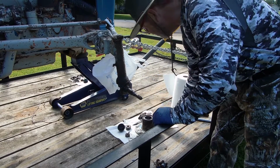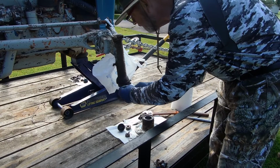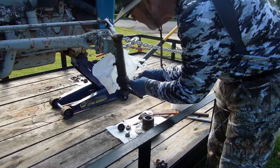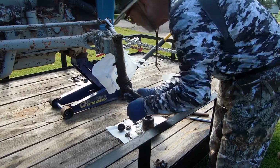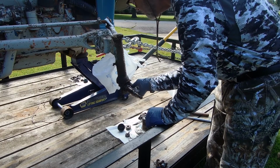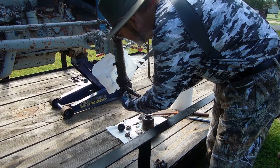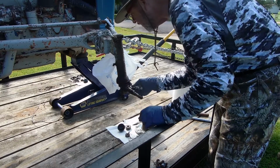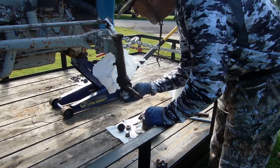And you talk about dirty. So that tells me that this seal was worn out and not doing a good job of sealing. And as you can see from the excess grease on the back here, all the evidence tells us that this was not sealing good. There we go. Clean that thing off good enough so that the shoulders on the new seal will have a good clean surface on which to ride. So that's important. Part of this job is cleaning.